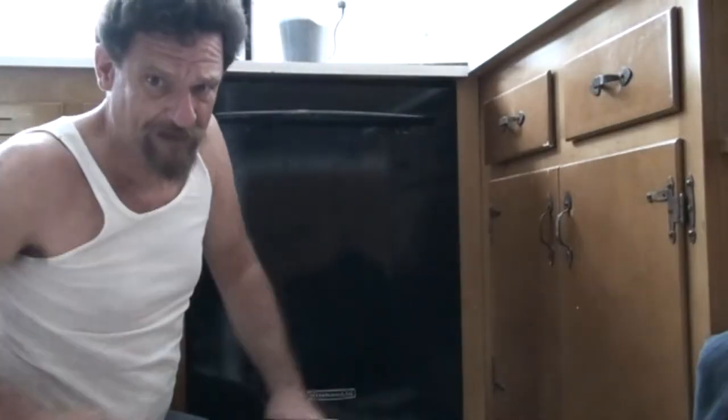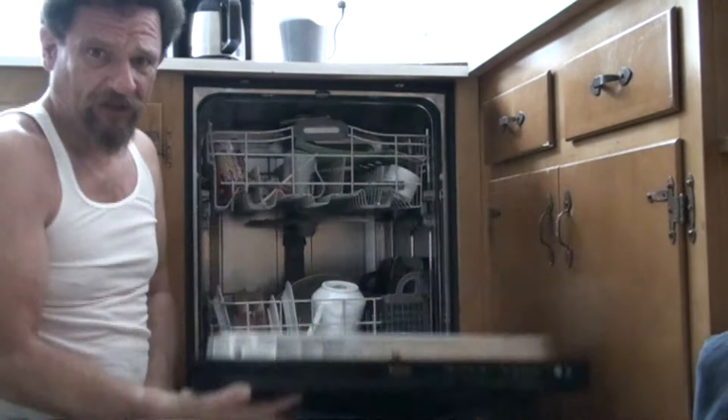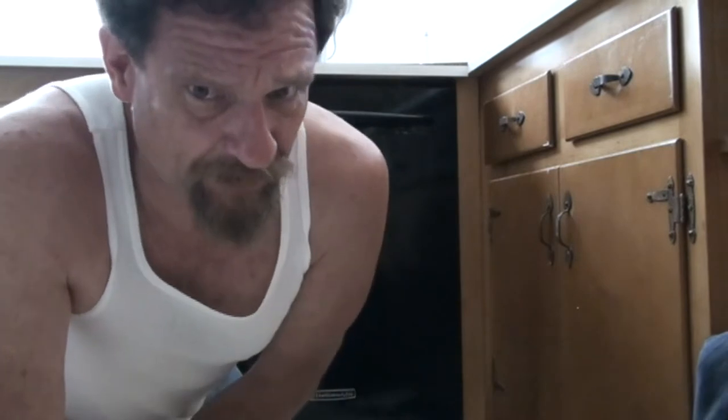The problem is two springs on the bottom on either side of the door — springs, strings, and rollers. Any one of which can fail. If just one fails, you'll get this 'fallen door syndrome.' Hardly ever do both break at the same time, but if you left one broken for a while, the other one would break soon thereafter.